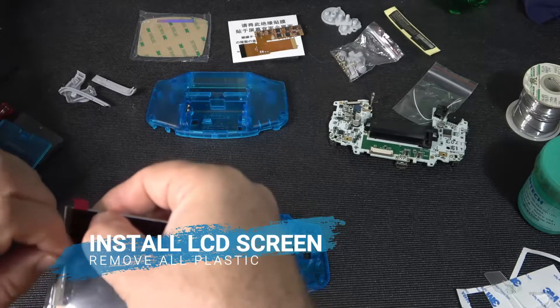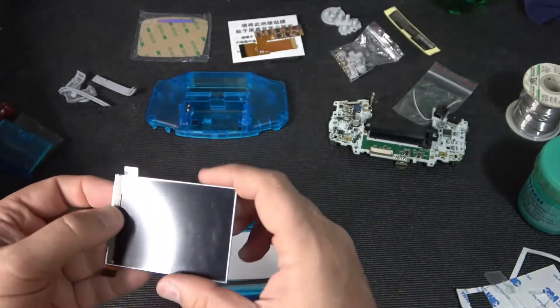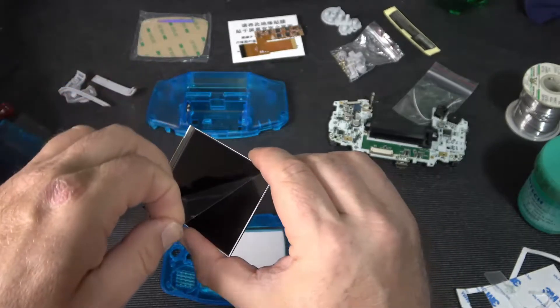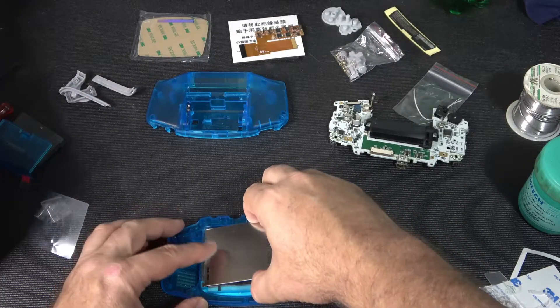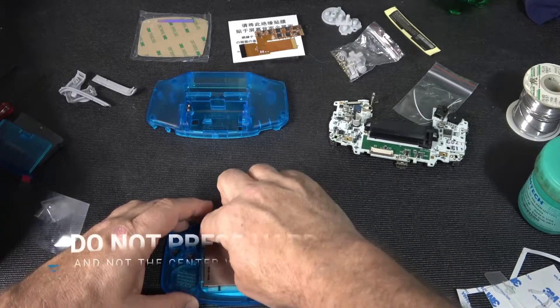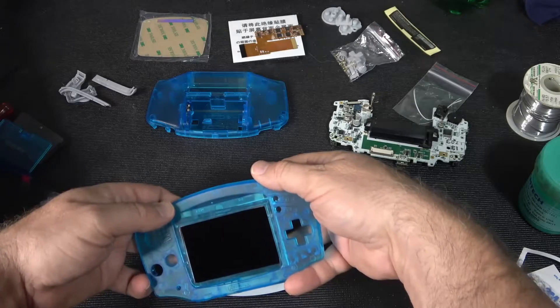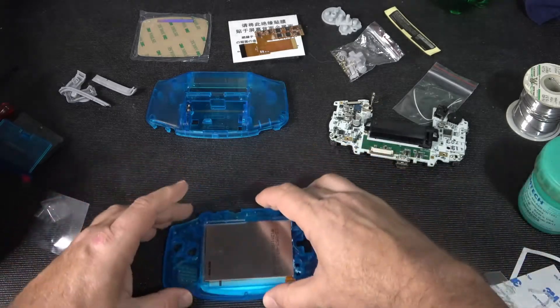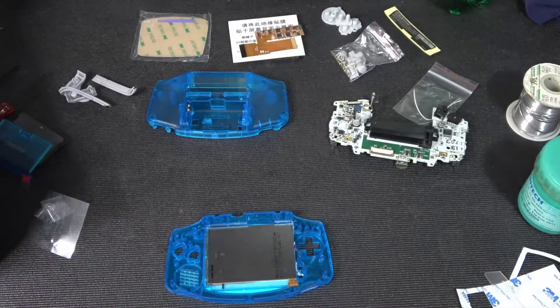When doing this, please be very careful taking off the plastic around the ribbon cable — it's a very easy tape but you don't want to pull and rip it. Do take off the film from the screen before installing — you will not get it off after. When installing, with the ribbon cable facing down to the bottom of the unit, never press on the center of the screen or you will crack it. Just run your finger across the edges so the adhesive gets contact and sticks. Your screen is mounted — this is a very easy job almost anyone can do.